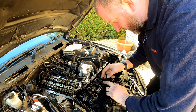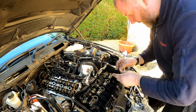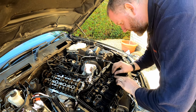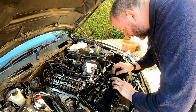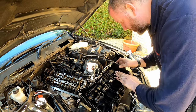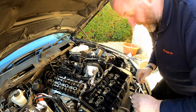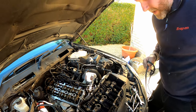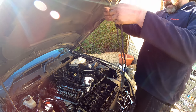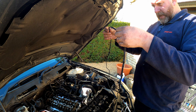The trick is when we lower the cover onto the cylinder head, to make sure that they don't fall off, because obviously that'll be bad and we'll have a leak. Hopefully they'll stay in place. You can use a little dab of RTV just to stick them in place if you so wish, but you don't need RTV to aid the gaskets whatsoever on this application. Okay, so now what we need to do is orientate this the right way round